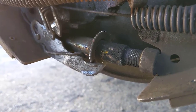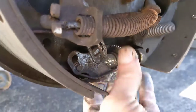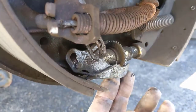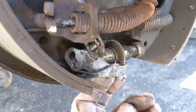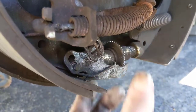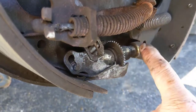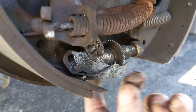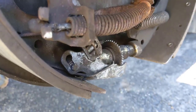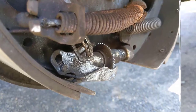Let's get to it. The first thing we want to do is pull the adjuster screw out. Now that you can get to it, you can hold it out and screw it in, which makes it a little bit easier. You just grab the two bottoms of the shoes, pull them apart, and this will pop out - you just pop the whole screw piece out.